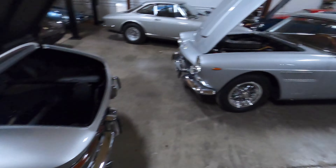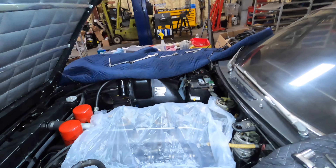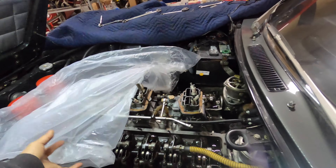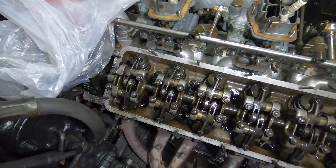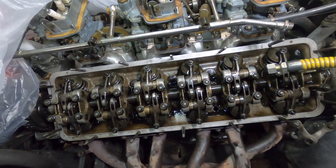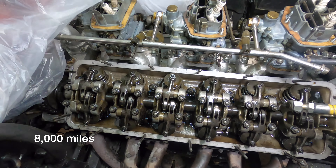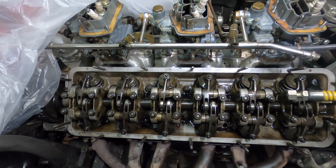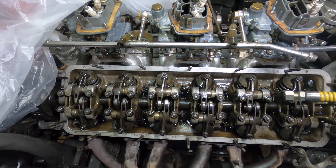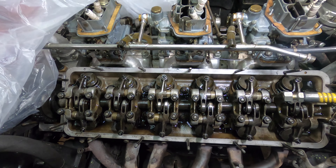From the GTC I'll go over to this car — a 365 GT 2+2. I'm doing a valve adjustment and a couple other things. I've known this car for a long time across a couple of owners; we're keeping track of the mileage and it was time. The manual calls for a valve adjustment every 8,000 miles, which doesn't sound like a lot, but with Ferraris and collector cars you're probably putting about 1,000 miles a year at most. This owner probably puts about 500 miles a year, so I'm sure he's never done a valve adjustment since he's owned it — at least five or six years.